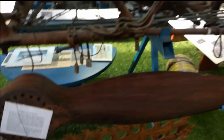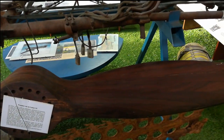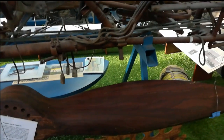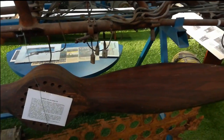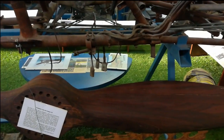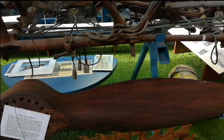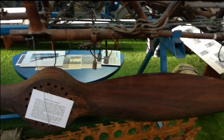The Fokker was made of wood. If it crashed, the wooden frame would crumble rather than damaging the engine. Wood crashing absorbs the impact — engine stops but isn't destroyed. Aluminum is harder and better for combat; a bullet makes only a hole and you can still fly. But with wood, a shot would completely break it apart. So for fighting, aluminum is better; for crash-landing, wood is better.